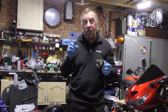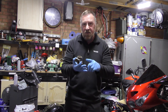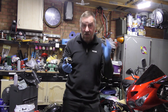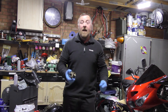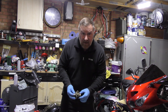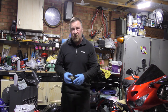You could quickly clean it off and spray it up, which I did with the Speedfight. But a lot of people have left this petrol in their tank. It swells plastic tanks, it damages the fuel filters, the fuel lines, the carburettor, the reeds as you go further in. Now you've got water and ethanol around your piston, the big ends, the small ends. You should never have water in your engine — and now you've got water in your engine. So when you boot into a garage, it's loads of money.